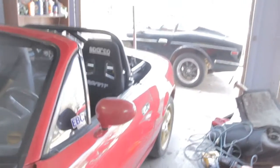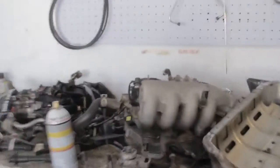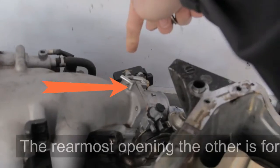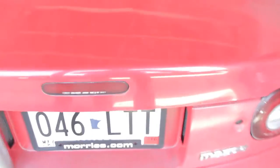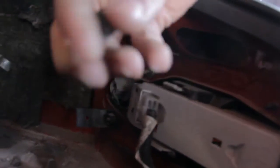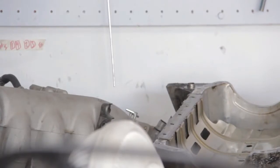Here's the unique thing about Miata mods and following forums. What I said is that you've got to take the hose that goes to the intake manifold and plug one of those ports. These are like the vacuum line hoses and I believe it's this one — no, this one. Anyway, it doesn't matter; since you guys are doing it on the car you'll know which one to take off. To plug that hole, if you don't want to go to the auto parts store, open your trunk and look inside. There are these little plug things that the bolts on the tail light have. This is the little plug you'll need to cap off your intake — use this plug and it fits perfectly.